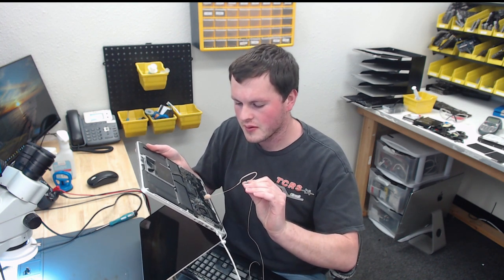Here in front of us today we have my all-time least favorite machine to work on, the A1425 from 2012. This is actually a fairly interesting case. We have a board that looks completely clean with no liquid damage that clicks. Typically that clicking is either a coil or a MOSFET. If we have a short, sometimes when that circuit goes under load, the coil will vibrate a little bit and you hear that click. Another case could be a bad MOSFET doing that.